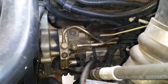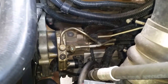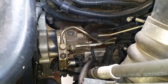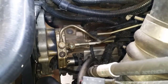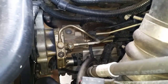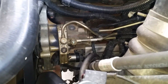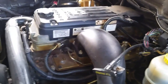Some of the problems you can experience when that thing starts to go bad are hard starts or rough idle. For me, I'm replacing it because while towing I'm getting the wait-to-start light error and the P12-22 code. On the review and log file of the engine running, it looks like the actual rail pressure is kind of lagging the desired rail pressure a little bit, and hopefully that's what's setting that code. There are quite a few parts to the common rail fuel injection system that can cause similar problems.